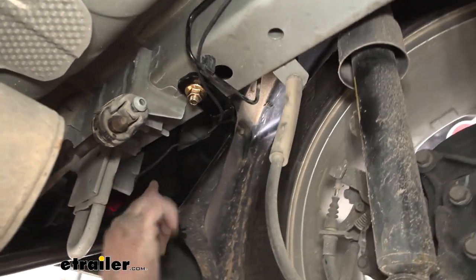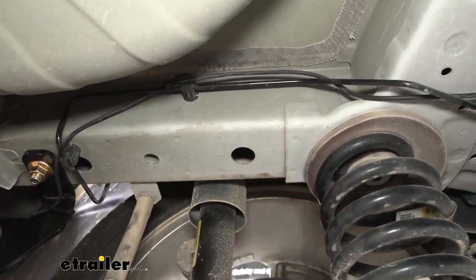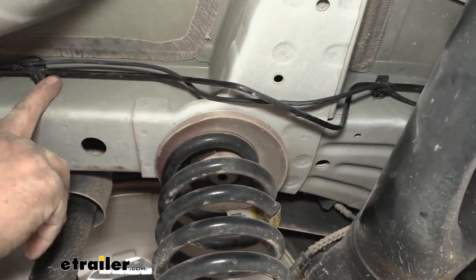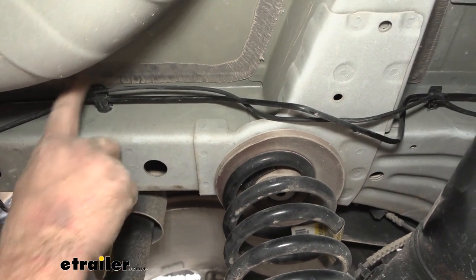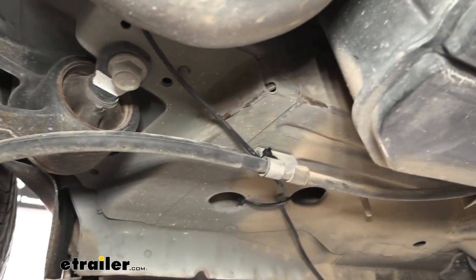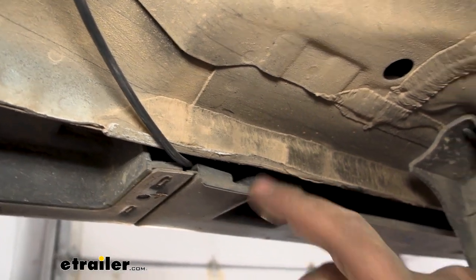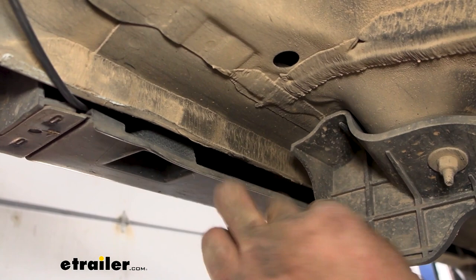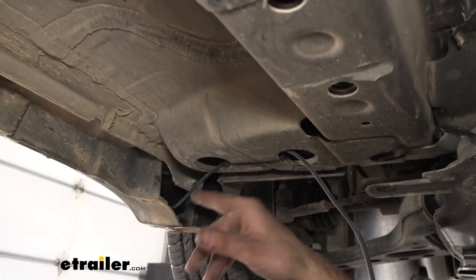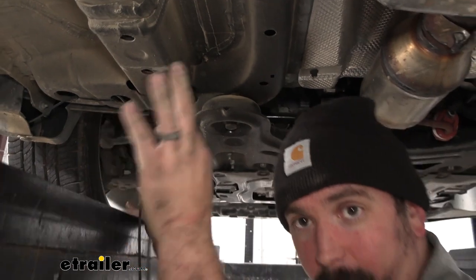Once we routed our power wire, I just followed some safe ways to get this up to the battery. The main thing is we're avoiding exhaust or any moving parts like suspension — I zip tied it to our hitch and just followed these hard brake lines. Don't zip tie it to the brake lines themselves, but on these brackets you can fit a zip tie through the top or bottom to secure it. I made a quick detour over to the side to keep it on the same side as the battery, then routed it behind the side skirt pillars. I was able to just fish the wire through those without prying them out.